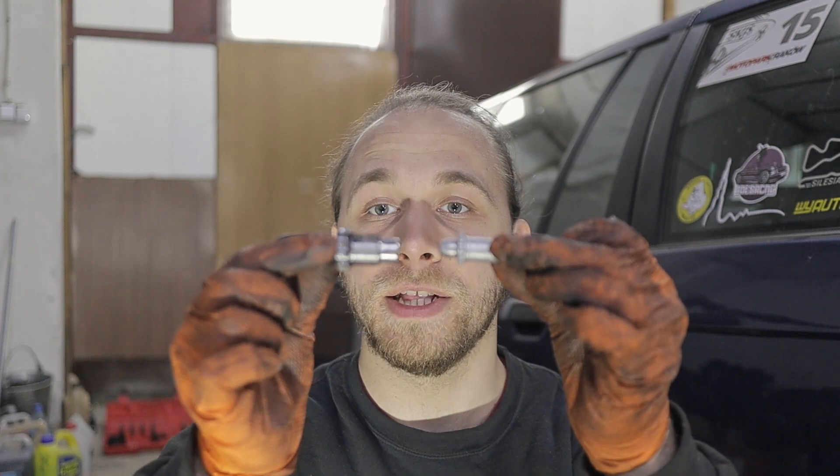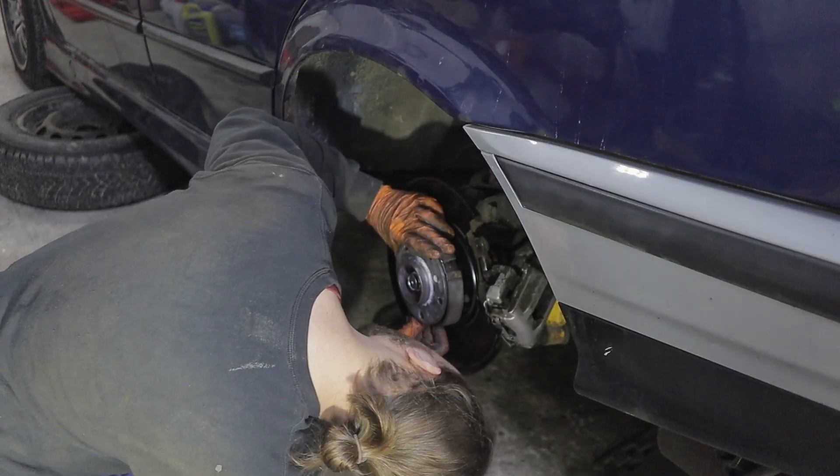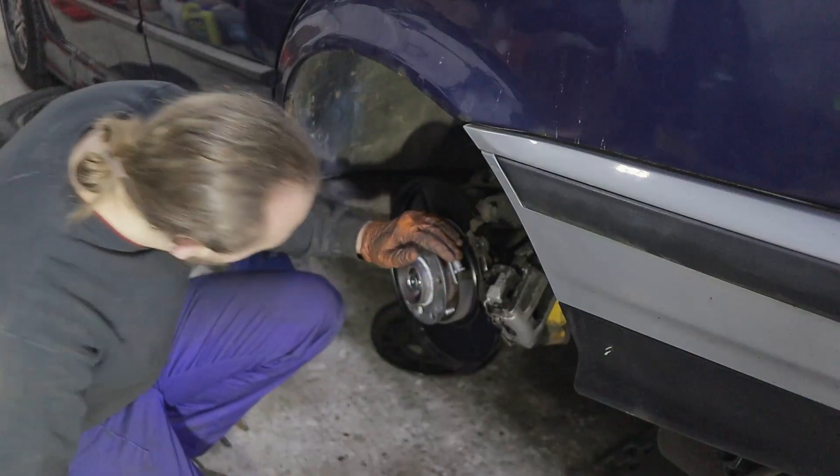The interesting thing about changing the rear handbrake system: I had an aftermarket automatic adjuster and I'm going with OEM, which is more expensive. Look at the size difference — with the aftermarket one there's very little space in the drum-disc setup and it's hard to adjust. The OEM will be much easier, and it's already pre-greased so there's nothing else to do.